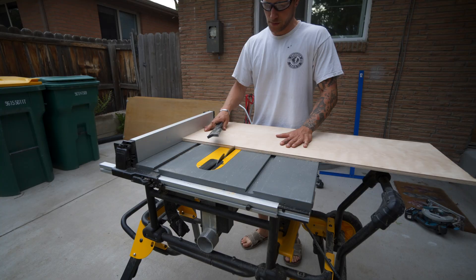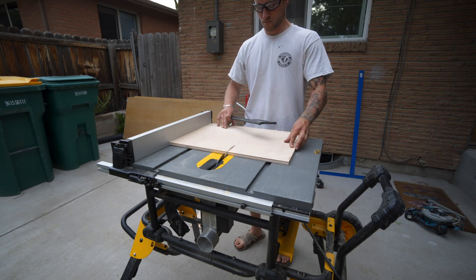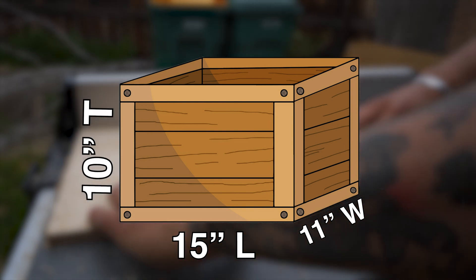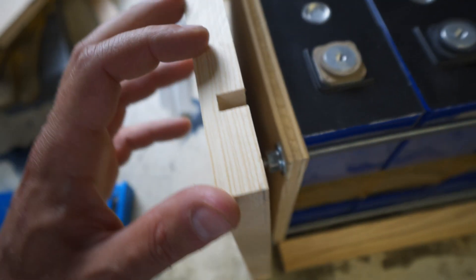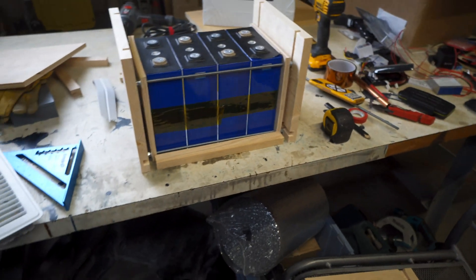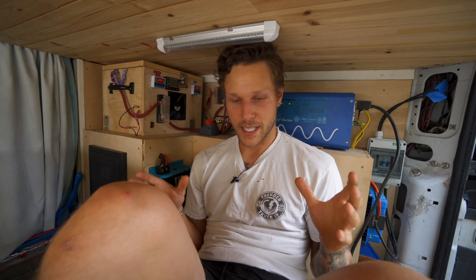Then it was time to build the actual battery housing. The overall dimensions of my box landed around 15 inches long, 11 inches wide, and 10 inches tall. I was so proud — I got all my channels cut and then put the battery in, and it didn't fit because the threaded rods overhanging on the sides weren't accounted for. So I had to improvise and cut a half-inch channel to fit them, and now they actually serve as guides so the battery sits in there very securely.